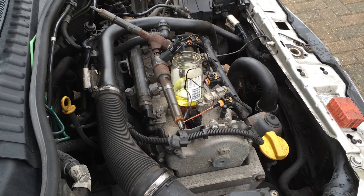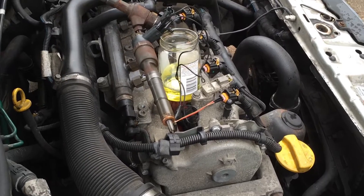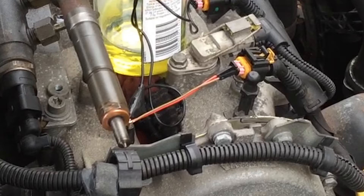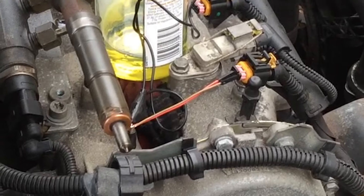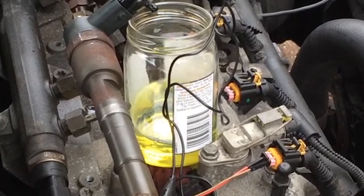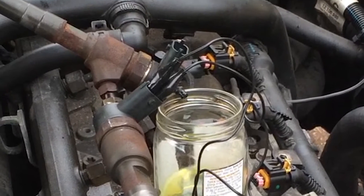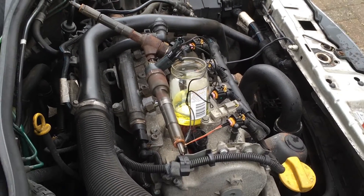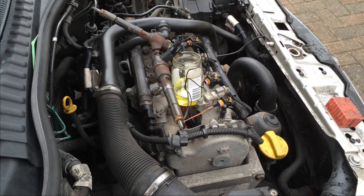So what I've done is taken two of the injectors out — they come out in pairs because of the way that they're clamped in — and I've reconnected them to the fuel pressure rail, but left them in the air as you can see. On one of them I've connected the electronics back to the wiring loom so that the car will fire the injector. The yellow jar that you can see in the middle is collecting the waste out of the injectors, because the collector pipe wouldn't bend in the way that I've got the injectors set up at the moment.